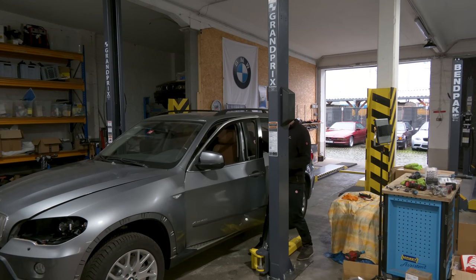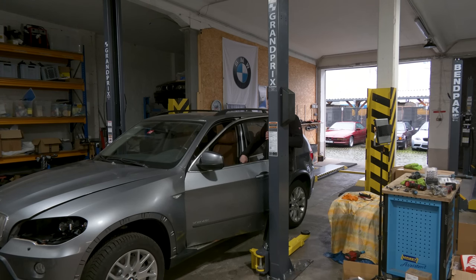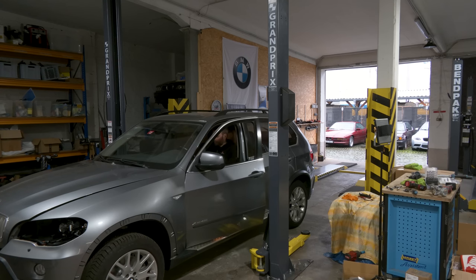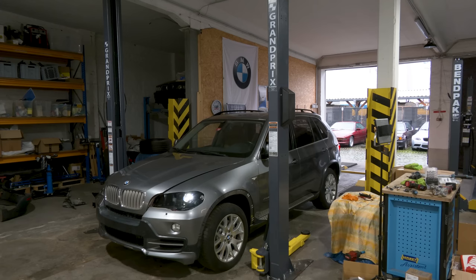All right, now you need a clean wall, flat surface, and about 10 meters of distance to make sure the cutoff line on the projector is aligned up perfectly. I don't have that because there's a lot of junk in front of me and this garage isn't exactly leveled, so we'll do our best. Might need to wait for darkness and take the car outside and then line it up somewhere.